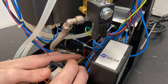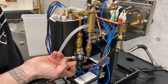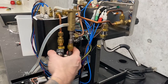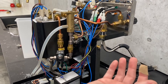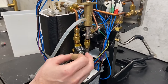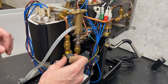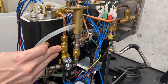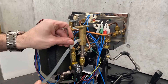Off of the pump, we come to this elbow joining to this braided line, which comes up to another elbow that finds us at our valve tree. This valve tree is in a lot of their machines — the same thing you'll see on the bigger models like the Synchronica and 700. Coming up here, there's first a fill valve solenoid, which opens up when your steam or service boiler is trying to fill. Right past that solenoid is a non-return valve, meaning water can only flow one direction.